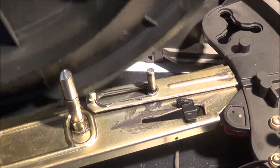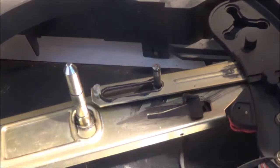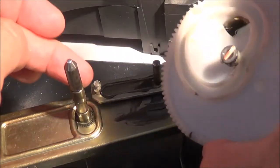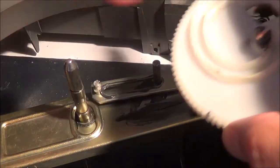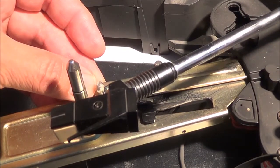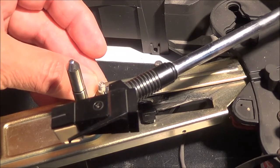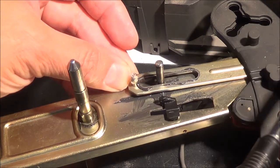That platter gear — since the gears intermesh and this pin is riding in this groove — is going to move that arm along with the pin. I'm going to try to simulate the conditions now. If you can imagine the cam gear turning and this pin riding in the groove, that pin is going to be pushed back like that. You can already see the arm going back.